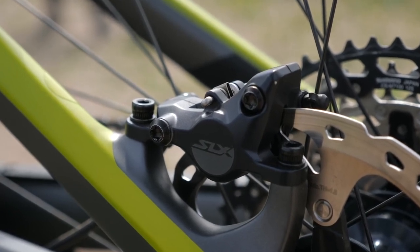I didn't think I needed it on the back because it's quite a big rotor — 180 is not massive, but the bike's light enough that it's super easy to lock it up. I'm not going to be doing any 45-minute alpine descents on a bike like that when I've got other bikes I'd rather take for that sort of riding. The best way to do this is stick with the same range of brakes. If you've got a Deore or SLX caliper, stick with the same — just get the four-piston option. You can mix and match, but they don't all work because some have different hose fittings. Some go in directly, some use the banjo system. If you've got SLX brakes, get the four-piston SLX and you know it's going to work. You'll need to do a full system bleed — take the pads out, use the pad spacer, fresh oil all the way. Don't be tempted to use what's in there. Flush it through and you'll know it's going to perform like a brand new brake.